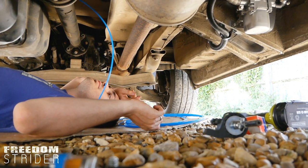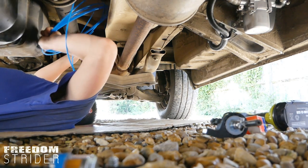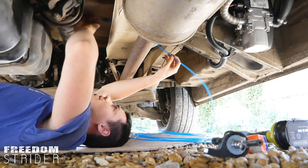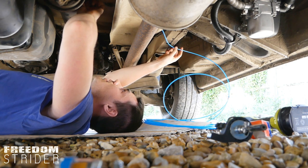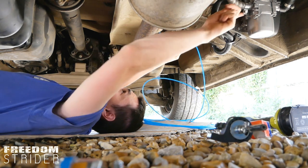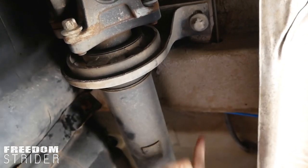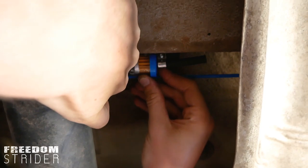We decide to route along a column, bending the fuel line over to the fuel filter, keeping it away from the handbrake cable and the spinning driveshaft. We're using tiny 4mm P-clips that clamp around the blue fuel line to attach it to the van. The fuel line runs from the fuel tank, over the drive shaft, to the fuel pump.